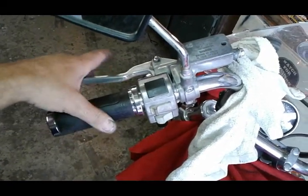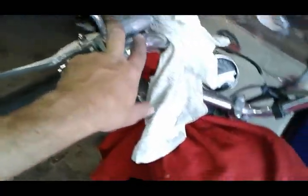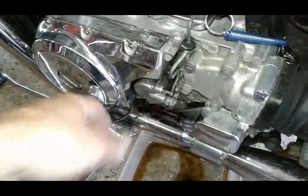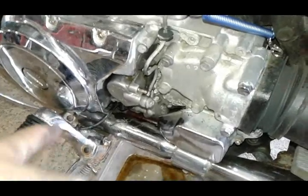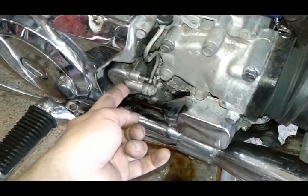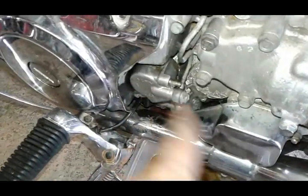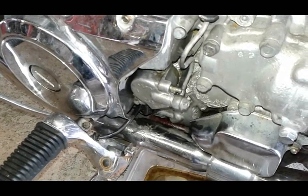We're pretty much done. I've got nice pressure on my lever. All I've got left to do is get some fluid in here, put the screws on the top cover, clean the bike up, and get the cover on the engine. I hope this was helpful and helped you understand how the hydraulic clutch system works. If you have a similar problem, just buy the rebuild kit — 99% of the time that's all you need. If you were to take this to the dealer or a shop they would change the whole master cylinder and slave cylinder and it would cost you hundreds of dollars. Doing your own work can really save you a bunch of money. Thanks for watching, please subscribe if you found this helpful.